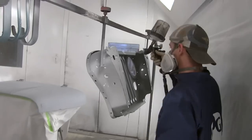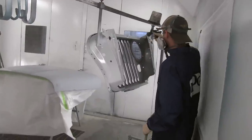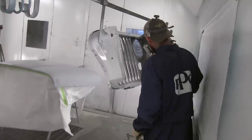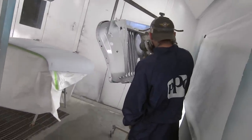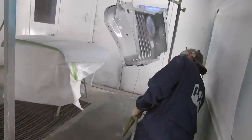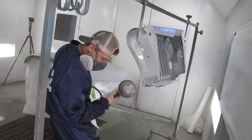Notice that he's painting a lot of these parts off the vehicle. It's not so important with a solid color, but this is gonna be a tricoat — it's gonna have pearl. You want to set the panels positioned the way they're gonna be on the vehicle. So like the grille sits up and down, and the hood is laying flat. Because if you don't do that, you may have a little bit of difference in the way the metallic or pearl lays, and it may give a slightly different color effect.